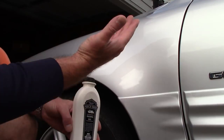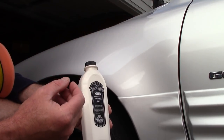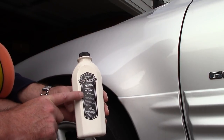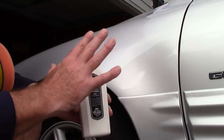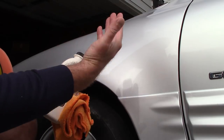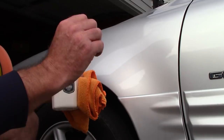This polishing wax works great. I would use it on my own well-maintained vehicles and on customers' cars that are maintained weekly, monthly, or just once or twice a year — whenever I just want to quickly use a DA polisher, restore a little shining gloss. If this car was well maintained, I could do a light polish on the whole vehicle in about an hour to an hour and a half. Meguiar's has a great retail-level polishing wax here — the working time, the appropriate expectations for light swirls and very fine scratches, and the fact that it wipes off so easily. I'll absolutely use it professionally for those moments when I don't need something as aggressive as HD Speed or Griot's Finishing Sealant — just a light little pop to the surface.